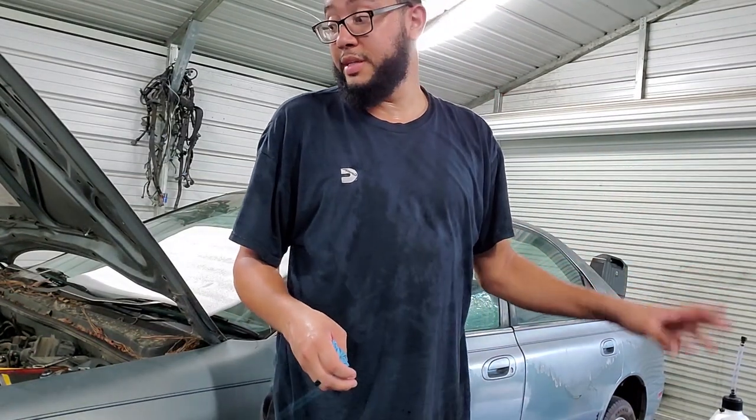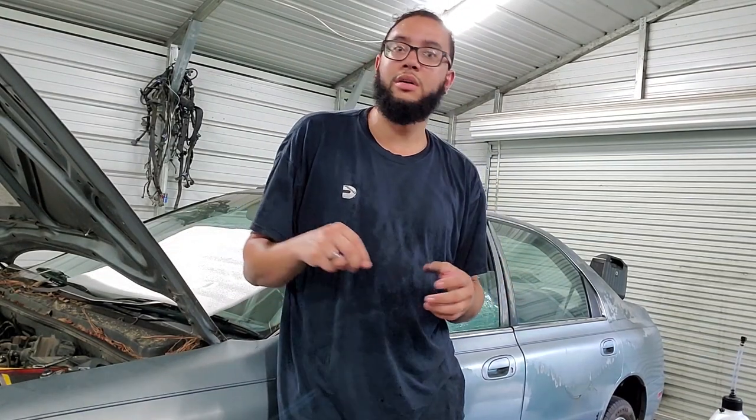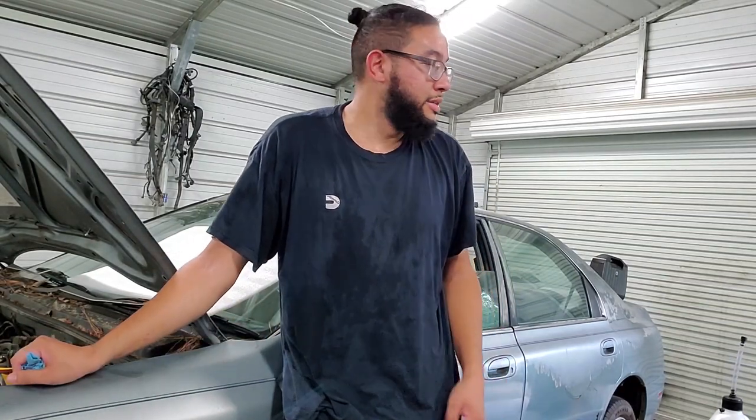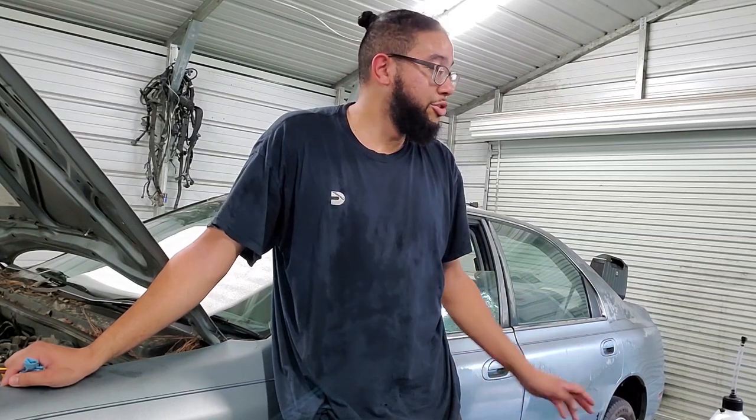If you notice, man, that suspension that was on here was really sketchy. Those are the coilover sleeve things that they came out with a long time ago, and everybody was buying them because they assumed it would allow you to adjust your ride height, and it don't really do none of that. And plus, you put it on a stock strut, so it's bound to just blow it out. It's just too much travel for that thing to keep up. So that's complete garbage, which is to be expected for something that's only $50. You knew that was just not going to work, but we were cool. I mean, Fast and Furious had all of us doing kind of dumb stuff at one point in time.